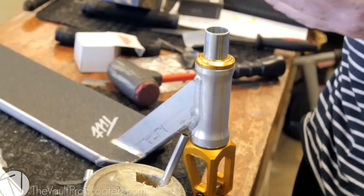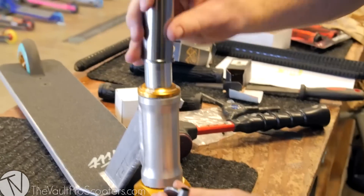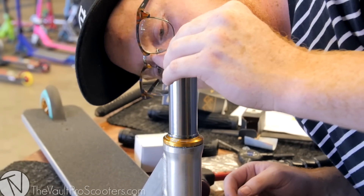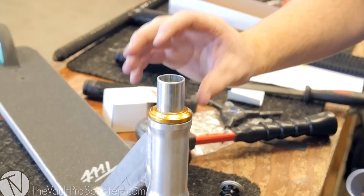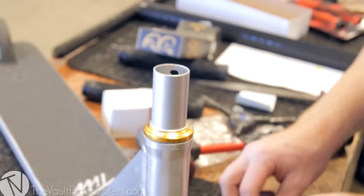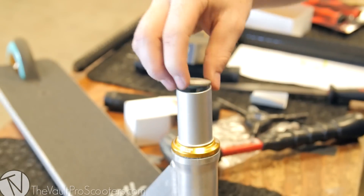For this build we're using HIC, so I have a Lucky HIC kit here. I'm going to grab a Phoenix HIC kit instead because the shim is shorter. You put that there and grab the fork — as you can see the fork sticks out pretty minimally, so with the smaller HIC shim it'll just slide right on. Put your compression bolt in, but it's still not long enough, so we need to find a slightly longer bolt.